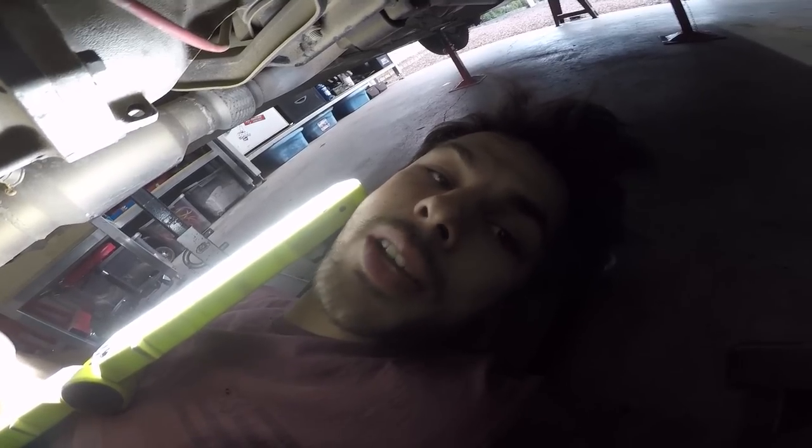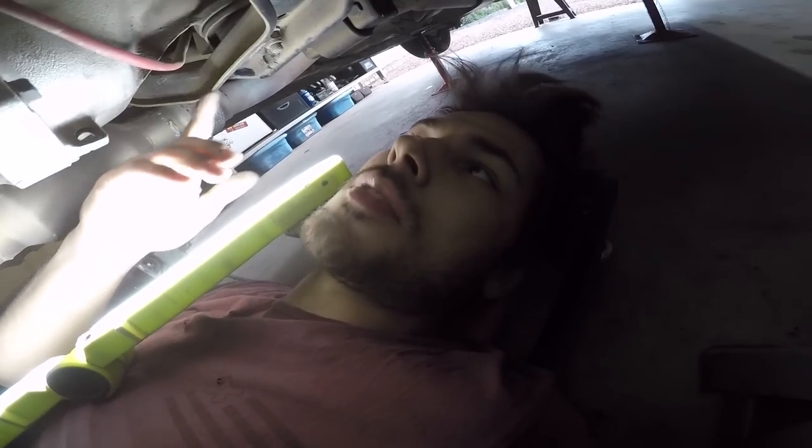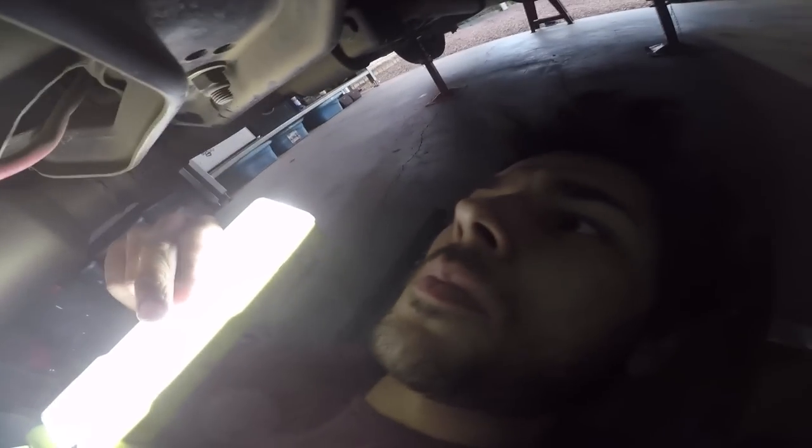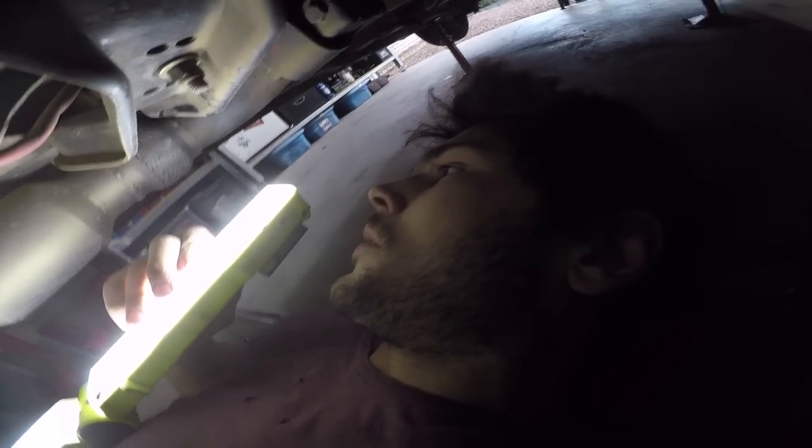On both sides. Now, with the Rod Shop mounts and Barra combination, I found out that the T5 comes back about 25 mil. So that's why I was able to use a standard crossmember and just slot the holes. This is currently running the XH, which has this single bolted style rubber. But for earlier E-series, that's why I've also got this other set of holes, so I can also bolt an EL or standard XF 5-speed into it. So that's all I did for the crossmember, and it works good, and I haven't had any issues with it yet, which is nice.